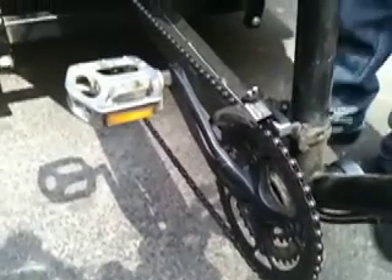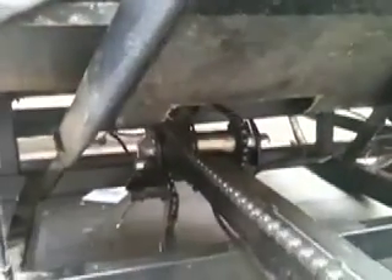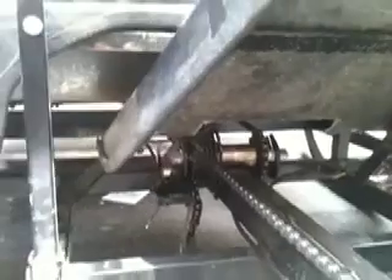Make sure your gears stay in tune — cables do stretch. Make sure all gears go through all three front positions for your own comfort. Most importantly, all seven gears in the back must work. Your bike has seven gears, going from seven to one and vice versa. If cables stretch or they're out of tune, tune it immediately. If you drive them when they're worn out, you will wear out your derailleur prematurely and it will cost you more money for parts.